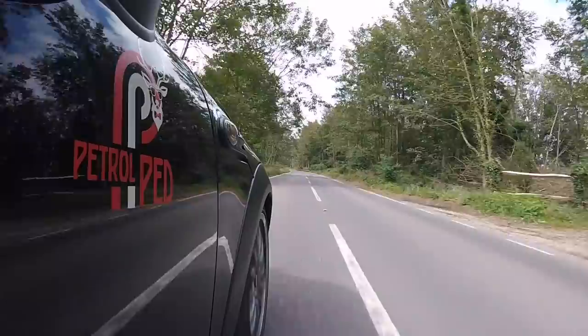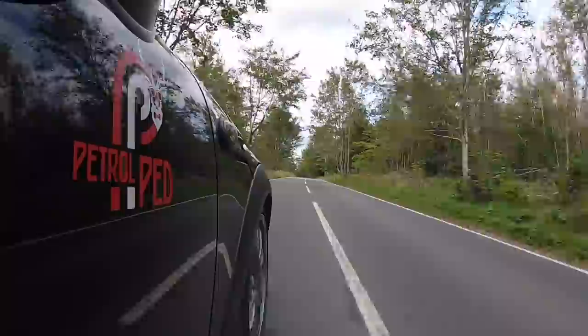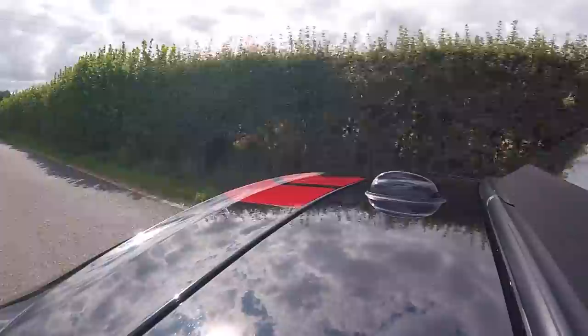It's quite light at the back, so you can rotate the car in the wet - you have to be a little bit careful, and I can see people might not like that. But for me, that combination of the fast road setup, having softened the dampers off a little bit, and the increased ride height just softens the feeling of the car and gives a bit more compliant ride. It's still pretty firm and pretty crashy in here, but it's way way better than it was, and it just makes the whole driving experience absolutely brilliant. I just can't express how different this car is to drive.